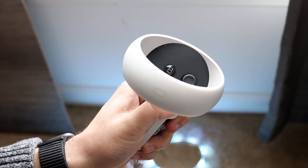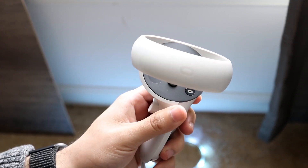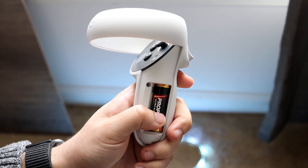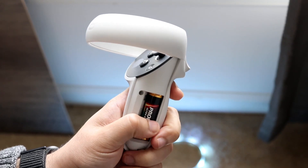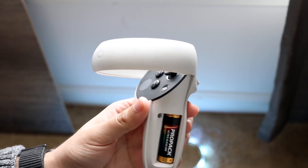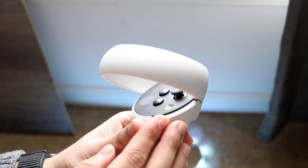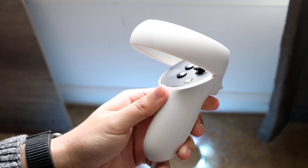You can see there was a blinking light when you hold it down. As long as you see that blinking light, you're good to go. If you do not see a blinking light, you may have put the battery in wrong, or you may have a faulty battery — so make sure the battery is fully charged, or replace it with a new one. That's honestly the easiest way to fix this controller not working.